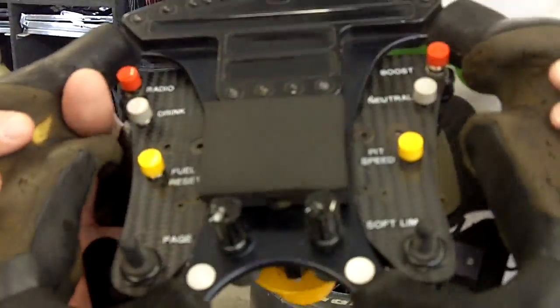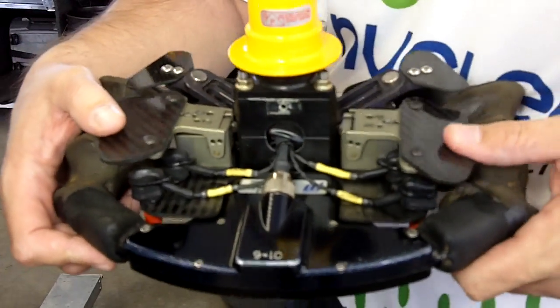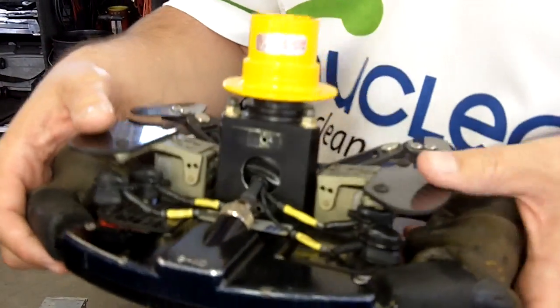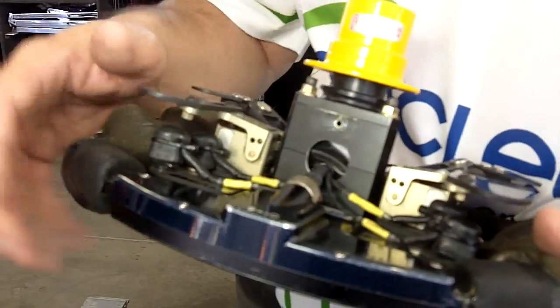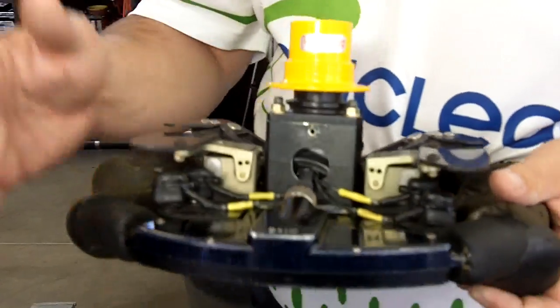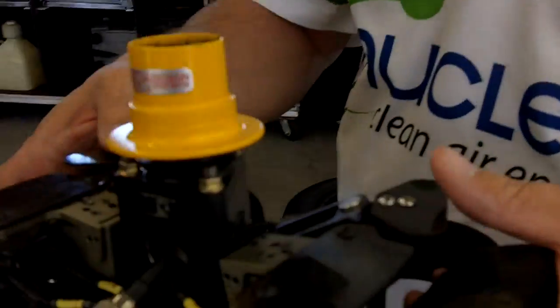On the backside, you have the upshift paddle — this is up, this is down — so when she leaves, she goes up through the gears and then down. When upshifting, she doesn't have to lift; she can keep the throttle flat and the car will shift while the engine automatically blips the throttle, helping acceleration. The bottom two paddles are the weight jacker — a sleeve on the right rear shock that extends and compresses. She can pull it to make the car more neutral, or pull the other to set the rear down more for additional understeer and rear grip.